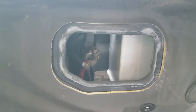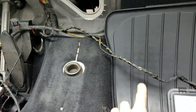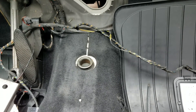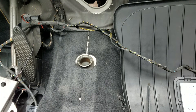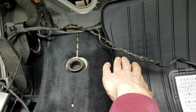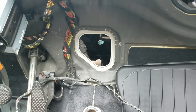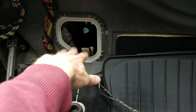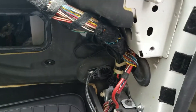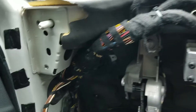That's the air box — you can see there's a negative battery cable and that's where your fresh air comes in. This little harness right here goes on the back of the air box itself — that's for the electronics for the blend actuators, those little servos that open different vents. Once this is put back on the box, it's essentially just going to sit in here — there's really nothing that holds it except it gets pushed up against this opening and just needs to be centered over that drain. There's a crash structure support that goes up on this pin, and there are two bolts on each side.